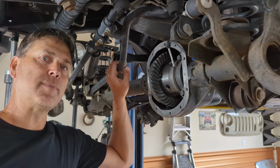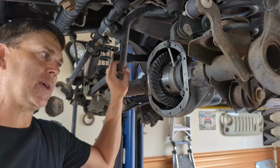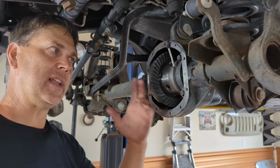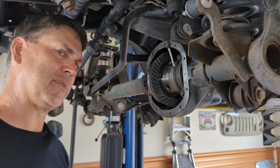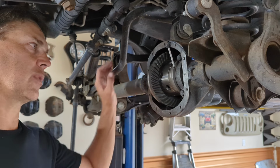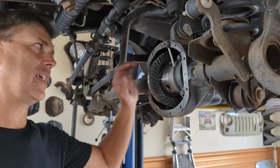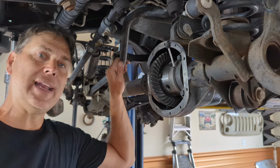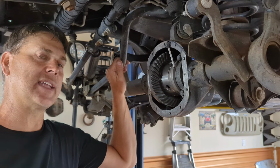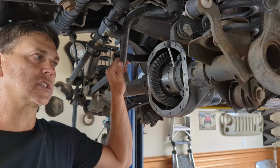What's your starting point on your pinion depth? So, trying to establish pinion depth. I know there's a lot of people talking about the numbers on the pinion head, you get a pinion depth checking gauge and all this stuff. You can work pretty darn fast without all that stuff if you simply start with what was in there. Now, if you happen to buy an empty housing, then all bets are off. You're just going to have to start making a stack and figuring it out from there.